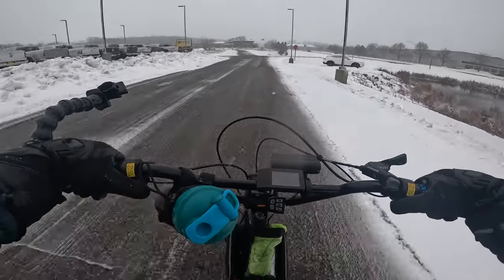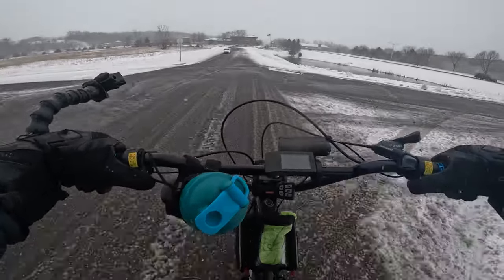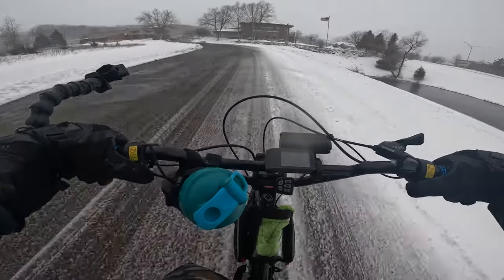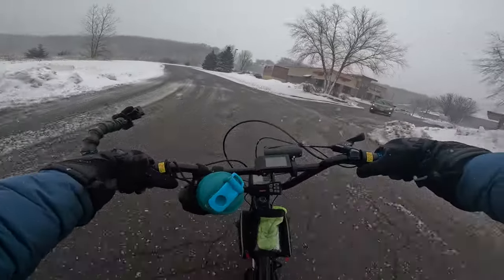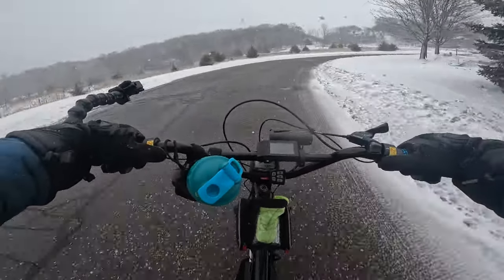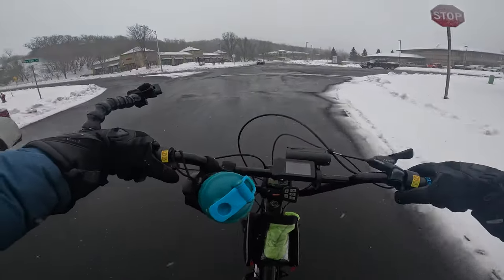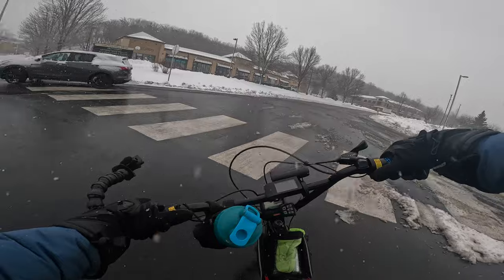We didn't get that much snow this winter, so I gotta get out and ride around in the snow a little bit. So we got two 30 amp controllers on this bike again, because my Frankenrunner controller, I keep having to send that thing back to Grin for RMA stuff. And they fix it, and then it gets a problem, and then they fix it. So they're just gonna send me a different Frankenrunner. So right now, I don't have two of the controllers that I need to use 72 volts on this bike. So I'm on 52 volts.